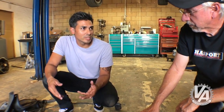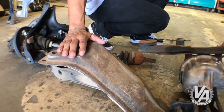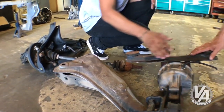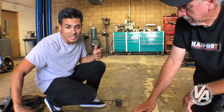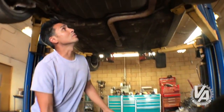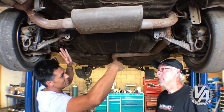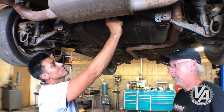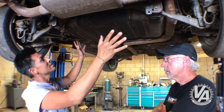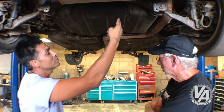Somebody who's really into the work is the one that's doing this. As of right now, this thing is kind of monstrous compared to what I've seen guys do. This kind of dips underneath the differential, whereas the stuff I've been seeing, they're really making like a cross beam across here. If we compare what we got here to the wagon, the wagon bolts in this area, and then you have the lower cross member. But to get all of this, it's like cutting all this out, and that means there's going to be a fuel cell — something we obviously need to address for the driveline to come through since there's also a gas tank.